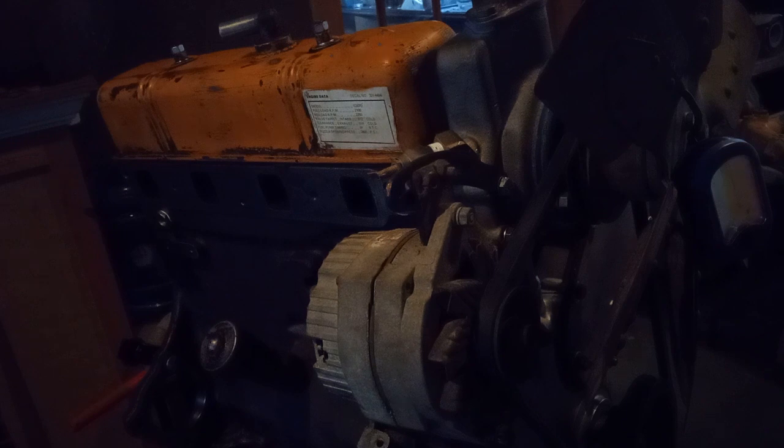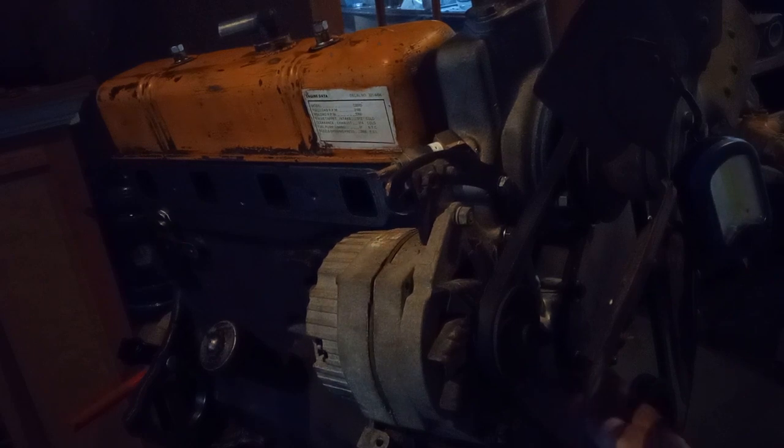When you put your pump on — it's four bolts — torque it down to 30. These covers were also 30. The book says 30 pounds if it's an aluminum cover and 42 if it's steel. This one is steel, but I find it odd that the housing itself is aluminum — so why would I want to do a higher torque on aluminum?